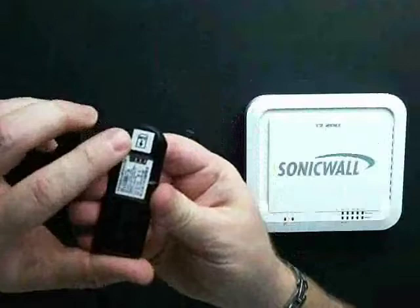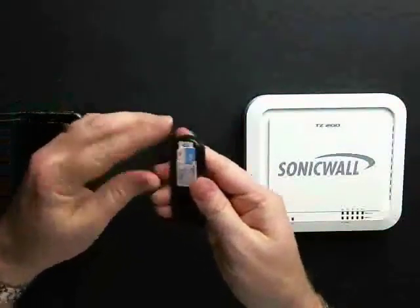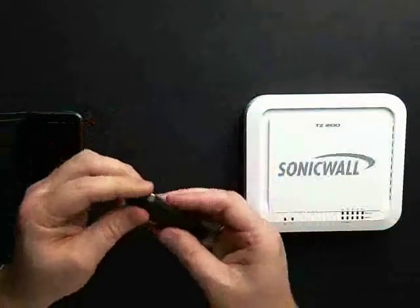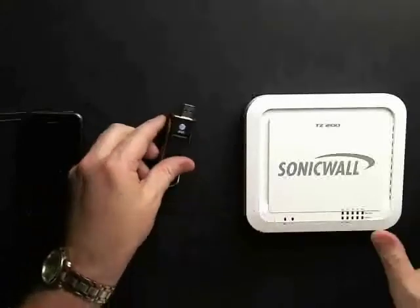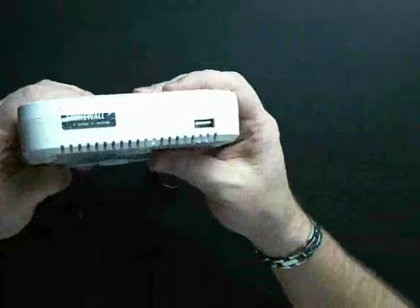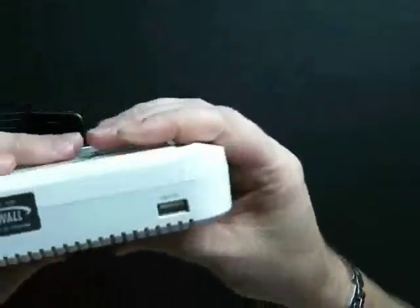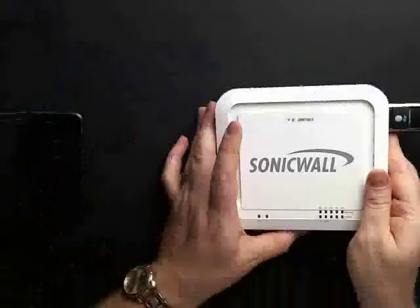As you can see, there's a little spot here for the SIM card, so we go ahead and slide it in there and return the back. We'll go ahead and open up the USB connection. Then on the SonicWall TZ200, on the side, you will see there's a little connection here called the U0 — it's got the USB symbol — and that is where we plug in the AT&T USB modem.